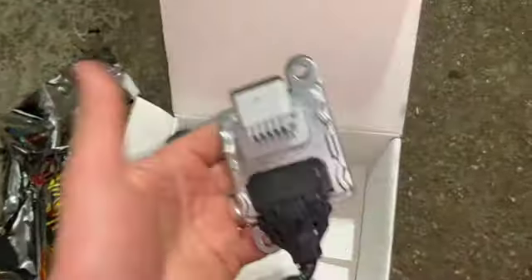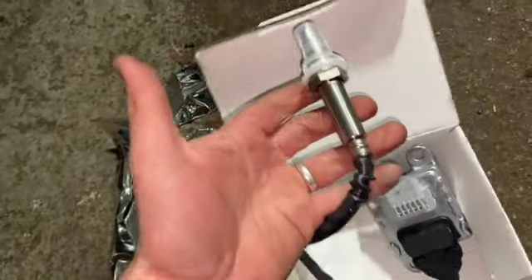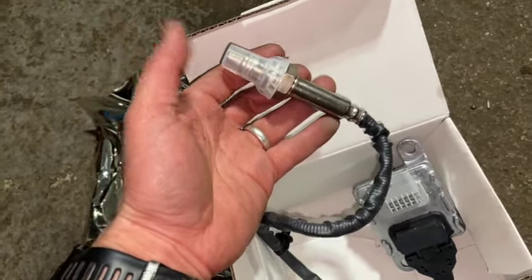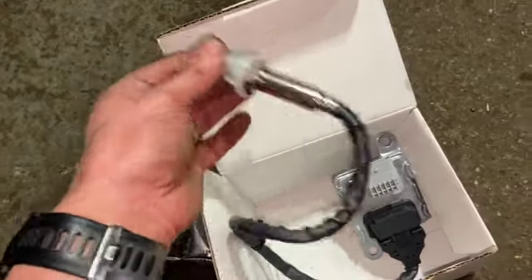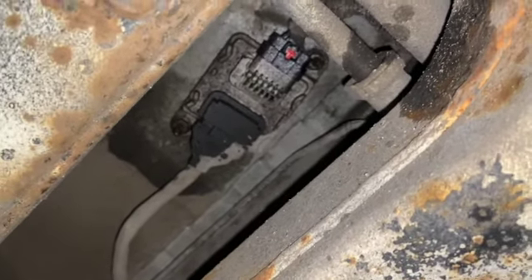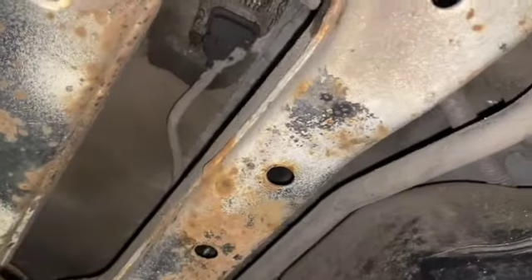Looking at the new sensor here — there's the ECU part of it. I've put links to all the part numbers in the description below. This is a Vauxhall one and it was just over £400 retail, so a pretty pricey bit of kit. Before getting the old one off, just take the connector off and check there's no water in there — that can be the cause of problems. I'll get this off now and we'll get it swapped over.